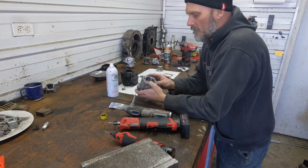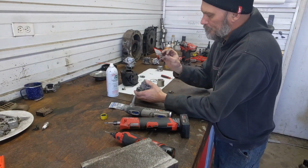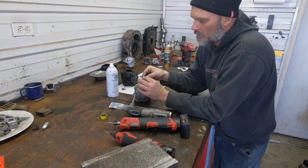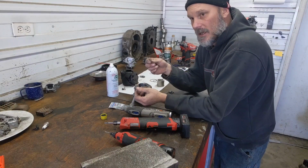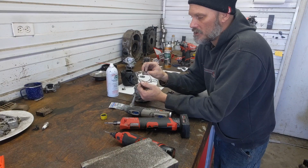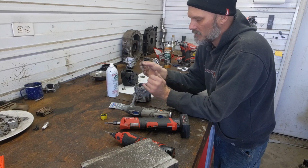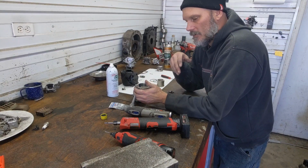Now on this saw, for you guys that like to run to delete the base gasket, the base gasket in this one is kind of a funky material that likes to flake off when you pull the cylinder. I would recommend, if you're going to put a base gasket back in it, to order a brand new one. I would not mess around with this cheap little part that may have a little bit of an air leak someplace where material is flaked off. There is enough room in the squish to go gasketless.